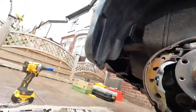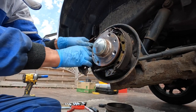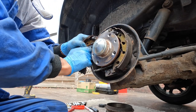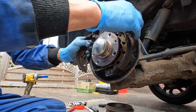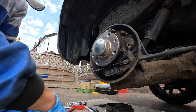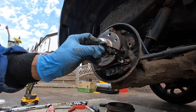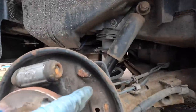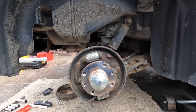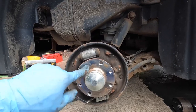I'll get the camera on the other side so you can see. All you need to do is pivot it round, like so. Then the whole thing just comes off. You've got your automatic screw adjuster here — give that a clean, grease up your pivot points. Job's a good one. No need to remove this hub — whoever said remove this hub is stupid.